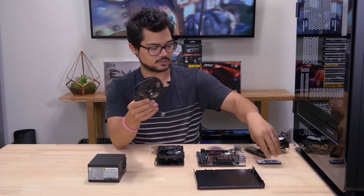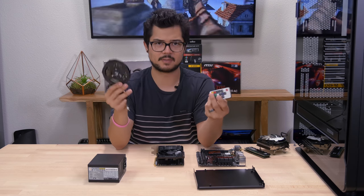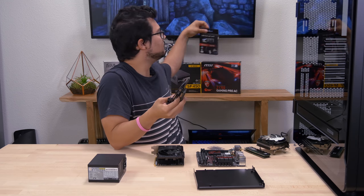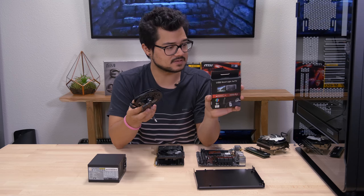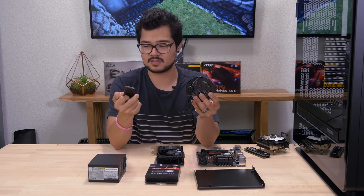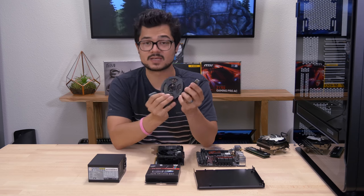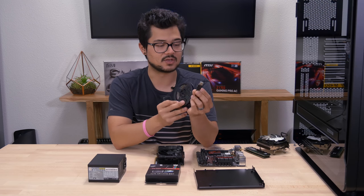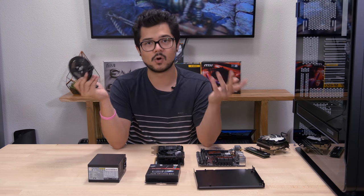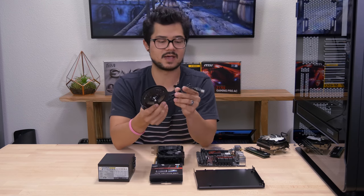And then finally, we've got some RGB lighting up in here. I was going to use an NZXT Hue Plus, and I figured that would be just way too complicated for a build like this. So we're just using this, I have the box over here. It's a USB mood light for your TV, actually. Designed for your TV. I picked this up off of Amazon. I'll drop some links in the description so you guys can check it out. It comes with a remote, so you can change different modes. It's fully RGB, and it's USB, which I think is the most important appeal for me, is that you can just plug this in directly to the back of the motherboard, and that's pretty much all the power you need. You don't need to deal with another Molex or SATA cable that you'd need to hook up to the power supply, further making things just a royal mess.